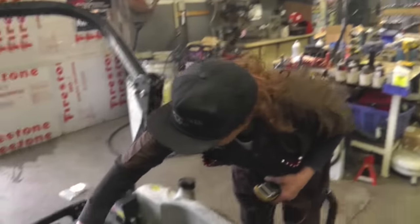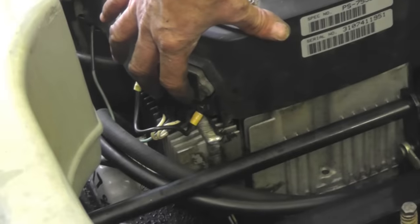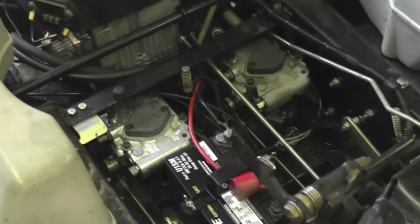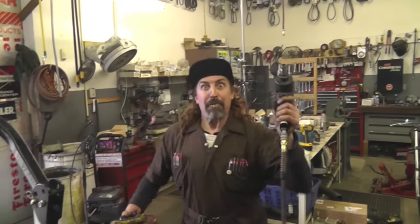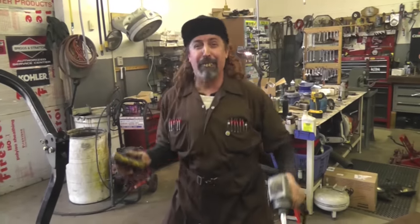Working. You see, we checked here the alternator from under the flywheel. It's putting out 43. Was it 43, Mr. Cameraman? Yep. And we saw that it was putting out 14 volts. So we fixed it. So there's your dinner. We'll fix another one here at Grass Grass Garage.